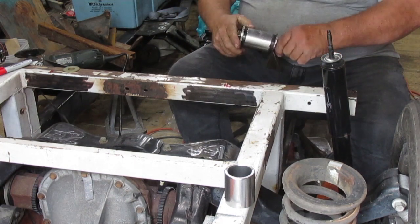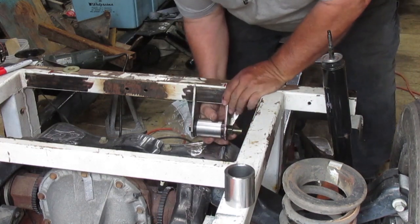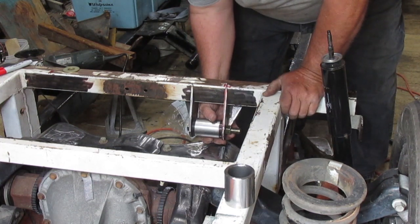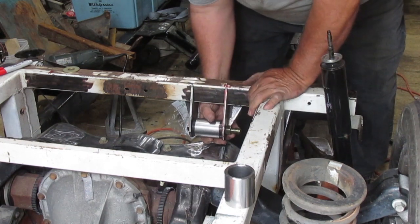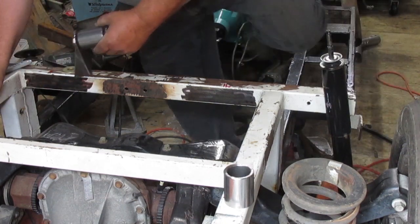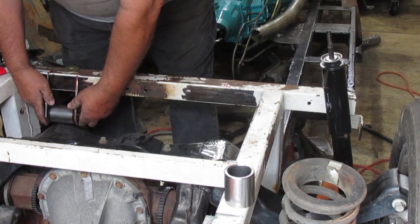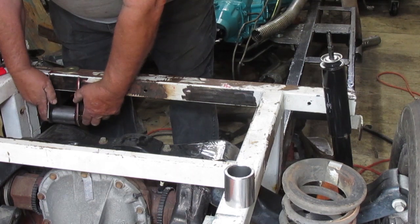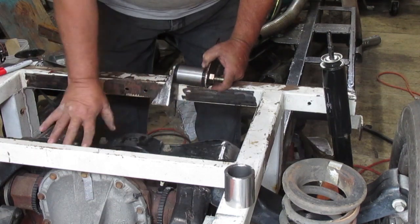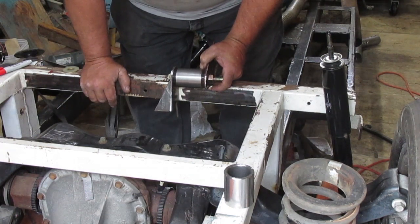But you still have a little bit of give so that we can get this in here just right. Now these are going to sit right here at three inches in on this side, and then I'm going to weld everything in place — tack these. Then I'll do it again on this other side, three inches in, and we'll have this side ready to go. Then we'll do the final placement of the rear end where it's absolutely going to go, and we're going to be able to make it work from there.